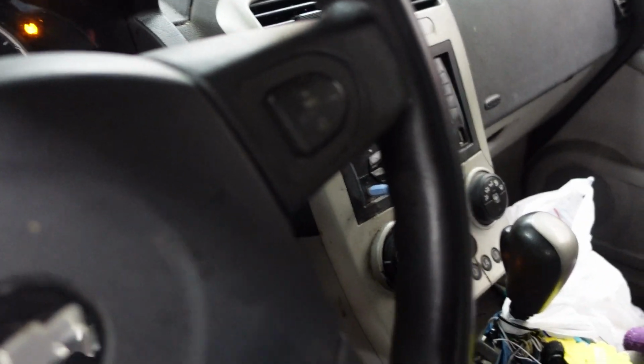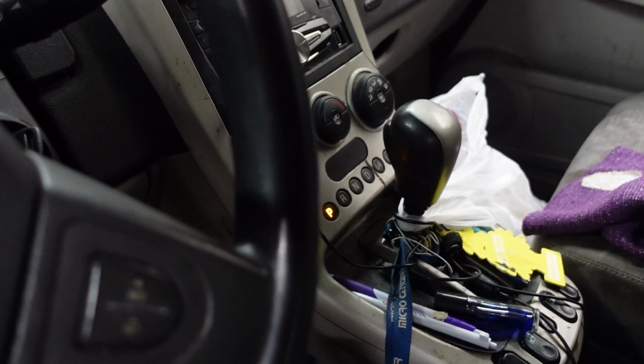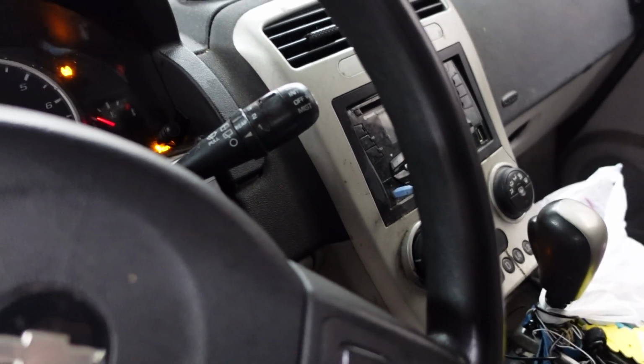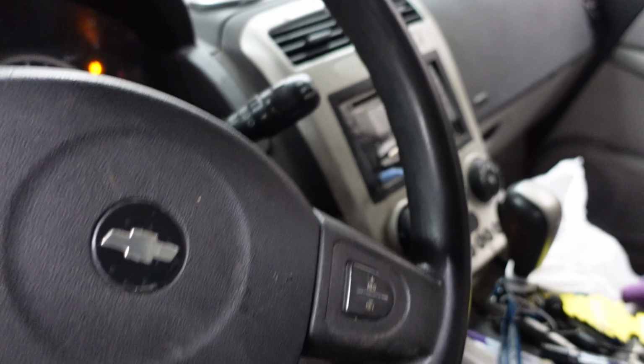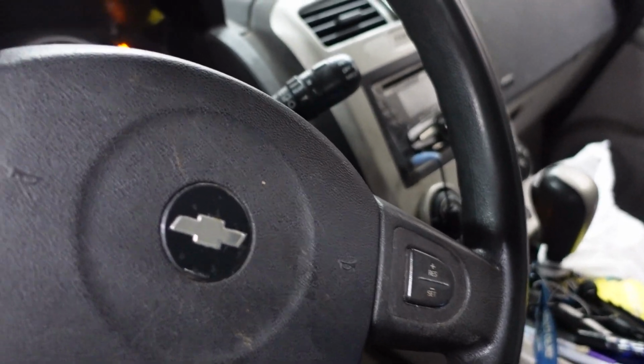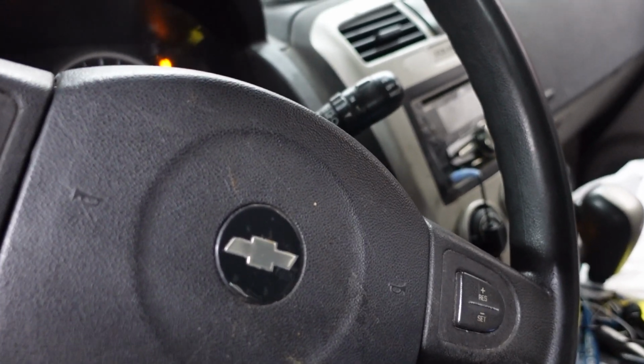Guys, the first thing I always do, check for a check engine light, check for a PRNDL. At this point, with not having any security codes in the PCM, I was led to make sure I had the crank signal request, as you saw. I had a request, but I also had a command. And so as you saw in this procedure, that quick, easy diagnosis gave us a lot of information. Not bad. It really gave us the direction to go here.